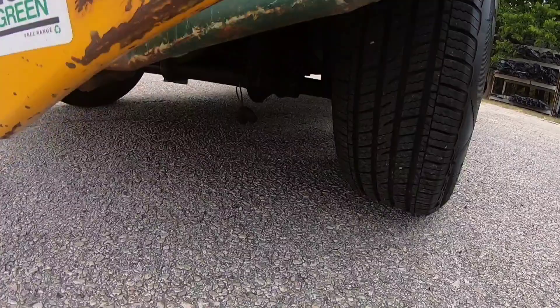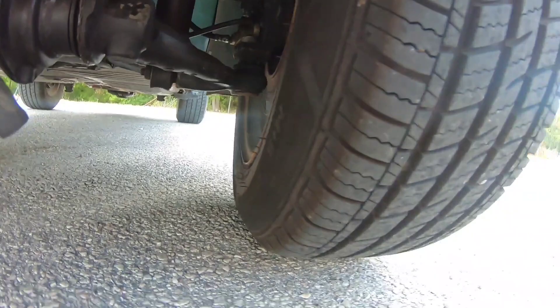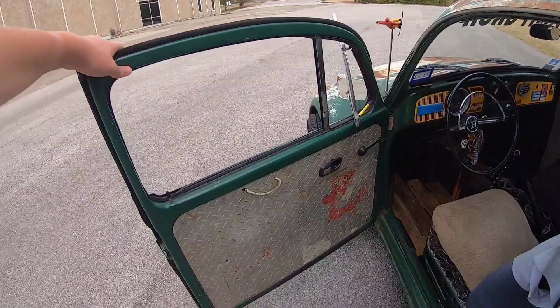I also did the AC Industries disc brake kit. You can see it's a rotor instead of a drum. I was a bit skeptical at first, but after driving around with it for probably almost six months now, I can say it really does help. If you're thinking about it, do it, because these cars come with drum brakes all around from the factory, and honestly it's kind of a death wish. If you're in traffic and have to stop super quick, they get hot too quick. Those disc brakes definitely make a difference.